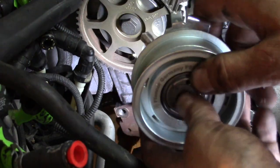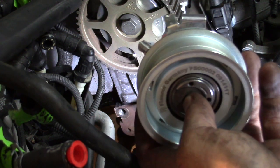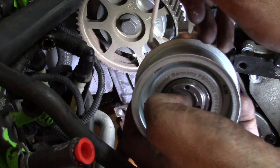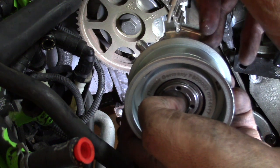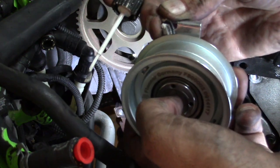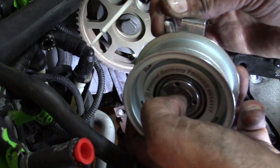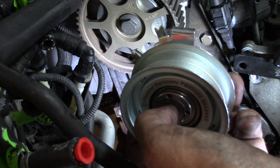Now for one of the things neglected in pretty much every YouTube video I saw — the installation of the tensioner, much less the setting of it. You have to set this in properly; you don't just bolt it in. Before I install it, I'm going to make paint marks on the indicator arrow and on the notch so it's easier for both myself and the camera to see. These will line up when the belt is installed and after the belt has rotated a couple turns — if those settings are still lined up, you know your tension is correct and you're not going to have a massive failure destroying your engine.